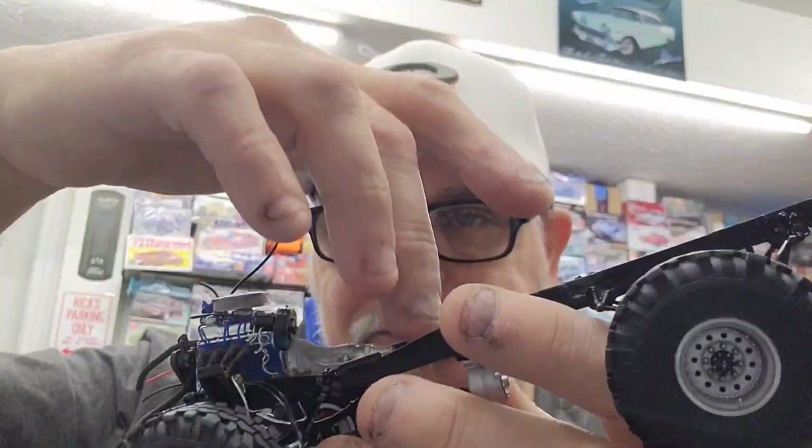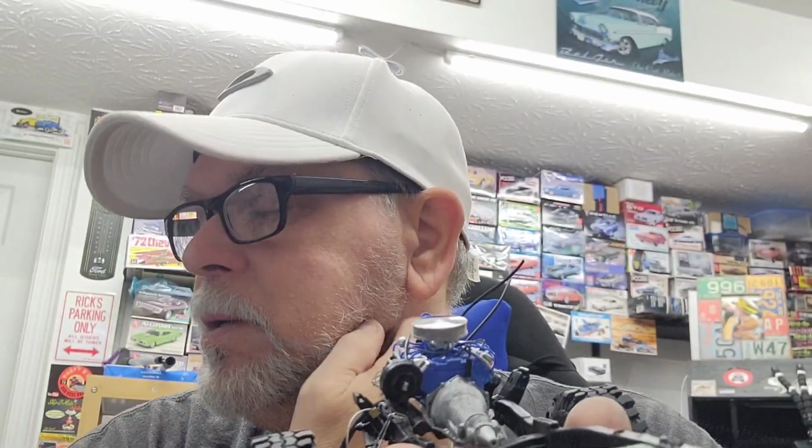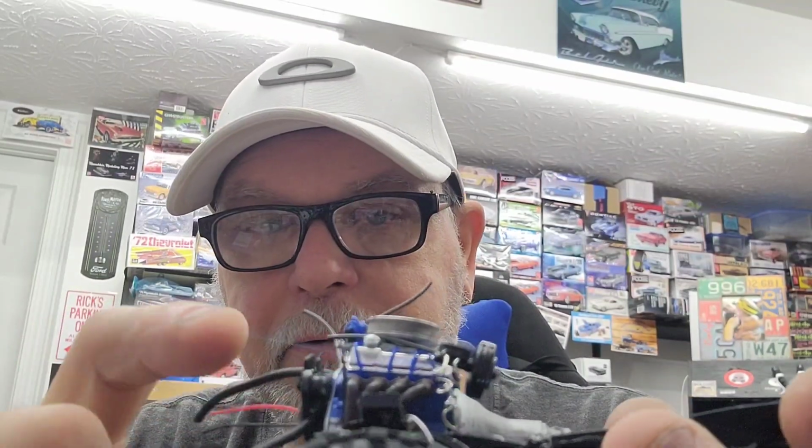So we are ready to mount the engine and trans. We'll get the final drive shaft in, get our power steering lines run, get our radiator in, and get our connections made to that. That way, all we're waiting on is to marry the body, and then we can do our other connections, our battery cables, heater hoses. The electrical part of it all will be done then.